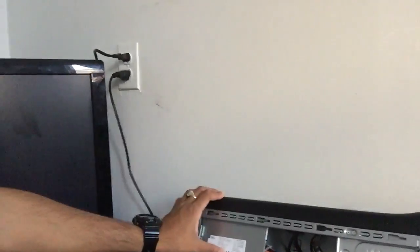Just a quick tip — the power supply, as you guys know, is the stock 460-watt. With this power supply you could go up to a GTX 970. If you go anything more than a 970, make sure you upgrade your power supply to at least 650 watts — then you could go with a 980, 980 Ti, or Titan X. But with this power supply I wouldn't go more than a 970.